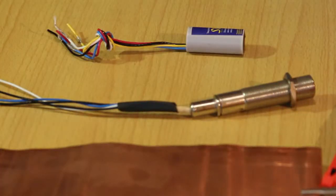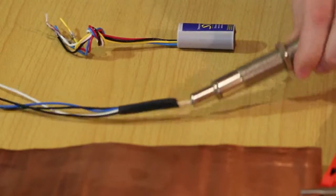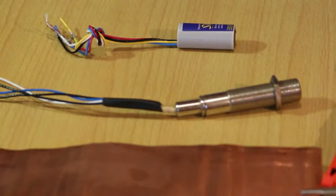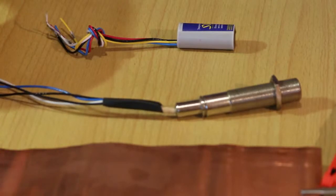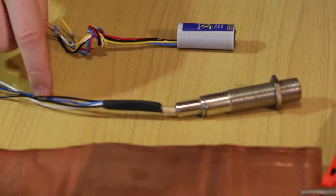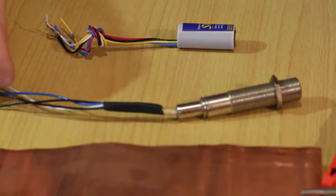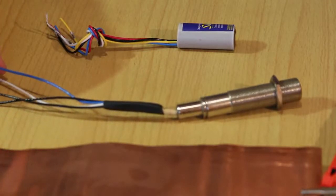Let's start with assembling the emulator SK-07. Here is the model of the car sensor. The color marking of the oxygen sensor corresponds to the marking on Japanese vehicles: black wires, white and blue wires. The black wires in this sensor are heating. Blue is the signal wire, and white is usually the mass.